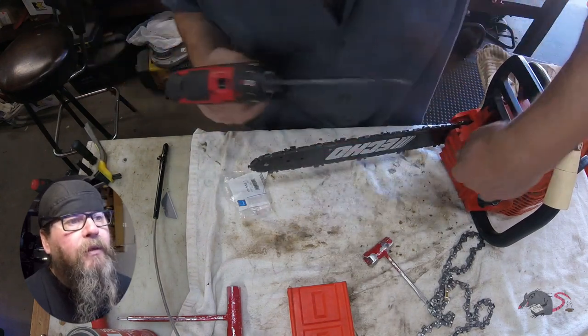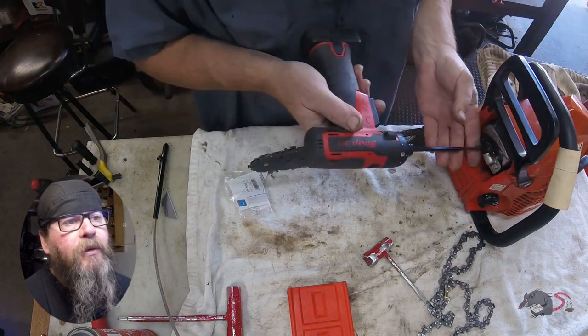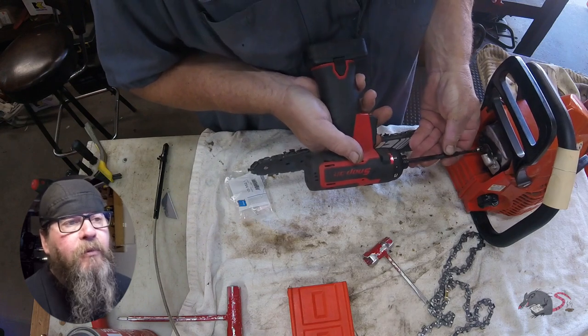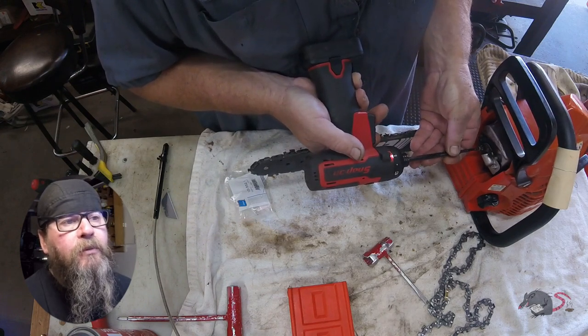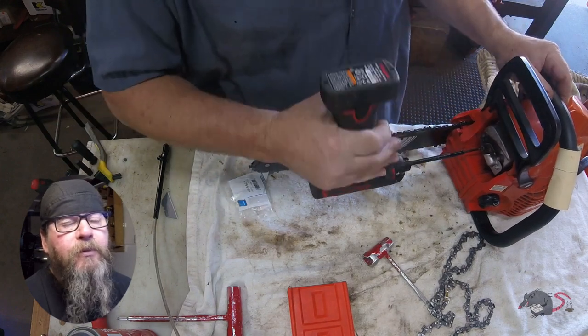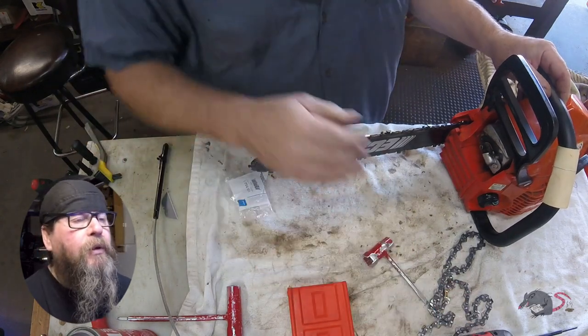This plate that holds this deflector plate, it's being a little stubborn here. And I'm being a little bit stubborn too, using the tool to start the threads on the bolt, but you know, if you do it by hand, you get a better feel for the first thread and you don't take a chance on stripping it.